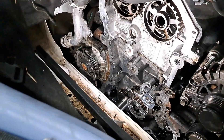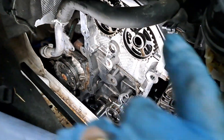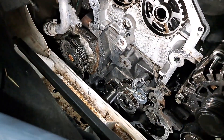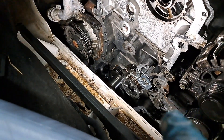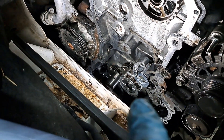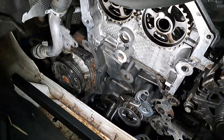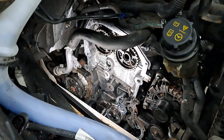So we've had a little clean up — washed it out with a bit of brake cleaner, got all the dirt off, scraped the face down to clean up all the silicone. I've already done the underneath where the sump goes; I've still got to do the sump, but that's fine. I've got the new tensioner in down there and I've got the new belt in.